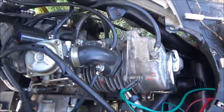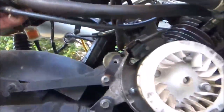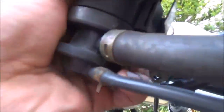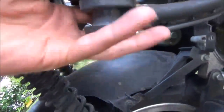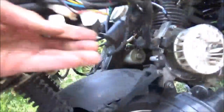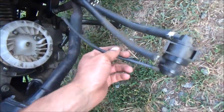I don't really make how-to videos, but here's the PAIR system and this is what I'm going to be removing. It's just hooked on here with rubber clips — kind of convenient. My panel's broken off so I can just move it. You just gotta get this little rubber piece off, and there it goes. The vacuum line to my intake was already broken, so no worries there.